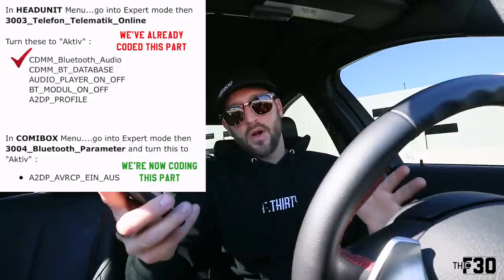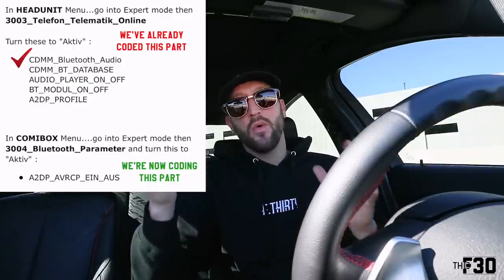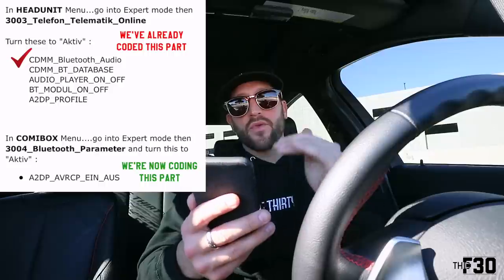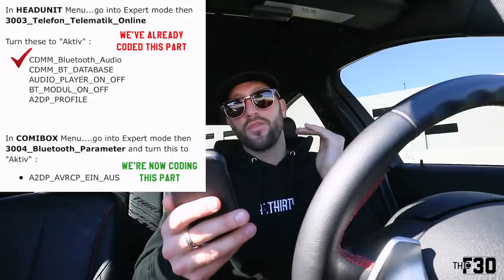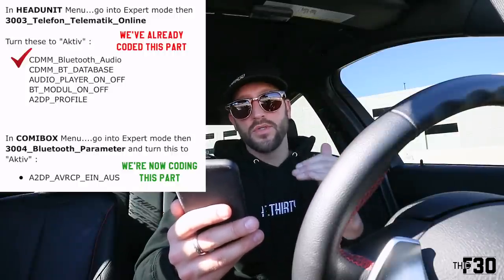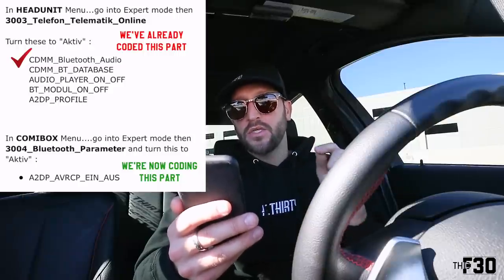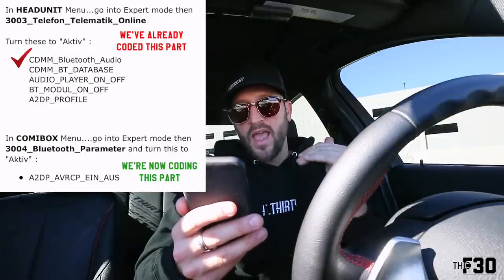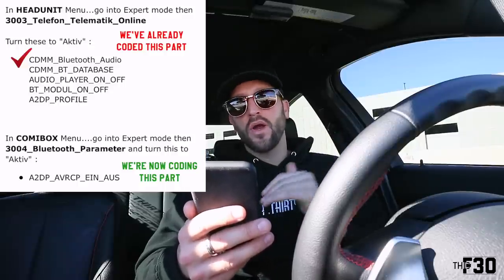For the next part of this, I'm not gonna be able to show you exactly how to do it. Why? Because I don't have a comm box in my car. So I'm gonna throw the instructions up on the screen on how you do this next part. Basically, what you're gonna do is hop into the comm box menu. You're gonna go to 3004_Bluetooth_parameter. And then under that, you're looking for A2DP_AVRCP_EIN_AUS. You're gonna wanna make sure that that is active.